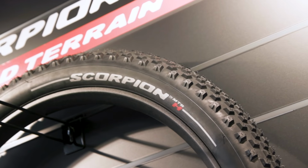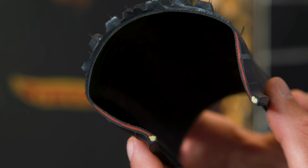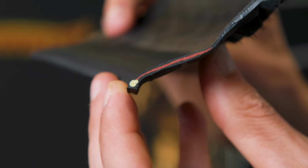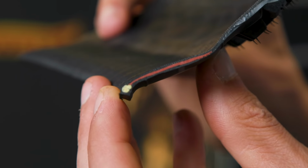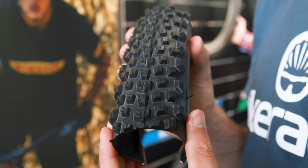The Hyperwall is patented in two ways. One is the sizing of the reinforcement put into the sidewall, which is as high as the full length of the sidewall. You see that the whole sidewall is much stiffer. And not only the dimension of the rubber insert, but also the fact that it is anchored to the bead itself by an added layer of fabric, which makes the whole piece of bead plus the insert behave in a dynamic situation as one solid piece.